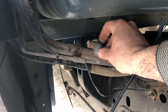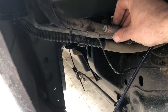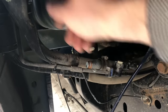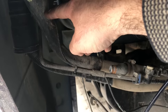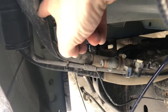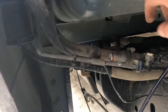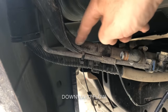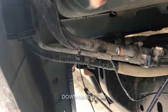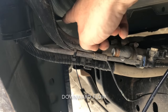This is obviously the filler line here. Just use a 90-degree fitting or whatever size you want. Get an idea of where you're wanting to put it and where your line is going to be running. You want to make sure it's placed underneath the tank. You also want to make sure it's a nice gradual flow into here so it doesn't have to go up and then down and cause an airlock. Sometimes when your tank isn't completely full, it has to be a straight shot out of your tank.